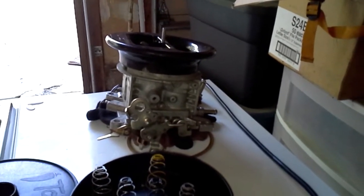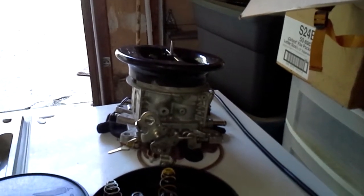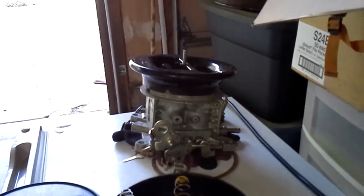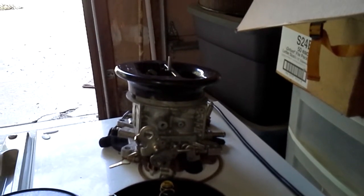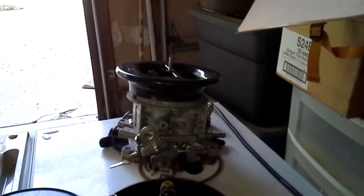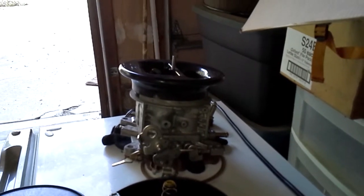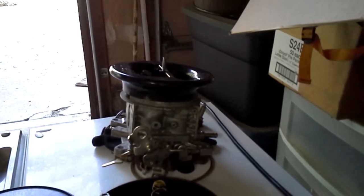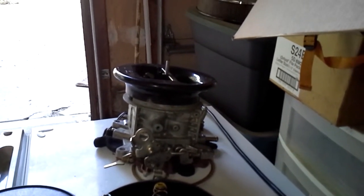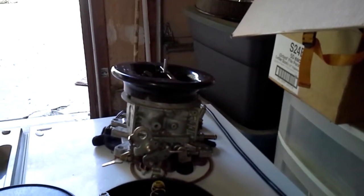So I took it out today. I didn't want to change anything else, so I just pulled out the purple spring — I've got a quick change secondary vacuum pod cover — and threw in the little short white one. Took it out for a test and it's like a whole new car. Keep in mind, I've had this thing running for well over a year and a half, playing with it, tuning the jets, the accelerator pump — got it running pretty good, I thought. Changing to that white vacuum secondary spring made such a huge difference. I can hit it from a dig or a dead stop or a roll, and that engine will pull cleanly to 6,000 RPMs with no hesitation at all. It's not howling like a quadrajet, it's not bogging — it's just coming on right and pulling to 6 grand every time.